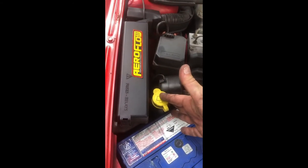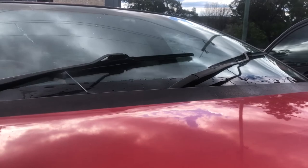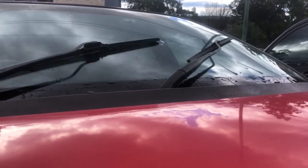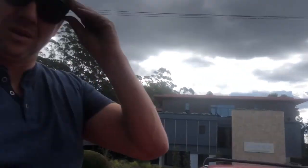I'll just fill up the water in the car and we'll test it out. That looks like it's worked really well. You can also aim those squirters a little bit better if they're not aiming quite right. In each squirter there are actually two outlets. I just noticed on my driver's side only one of them is squirting - what you can do is get a toothpick or a needle and clean out the other side so they both squirt.